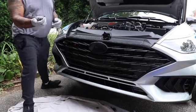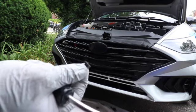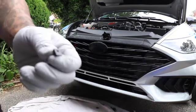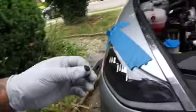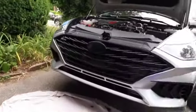These right here. If these stay in, it won't come out with the DRL, it's gonna be a pain, because you gotta get these, and then let me show you. You gotta get these and then slide them back in this groove right here. I don't know if you can see that. There's a groove and you gotta slide it. Slide them back in that groove, and then when you push down into the white pieces, that's what holds it down. So it's a little tricky.